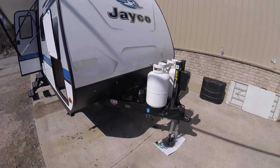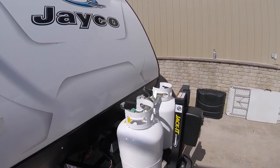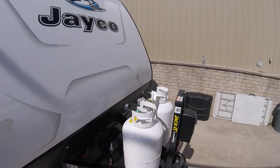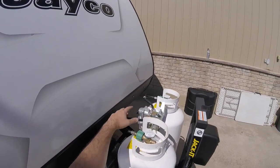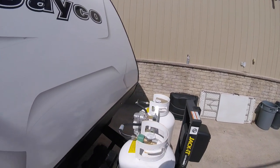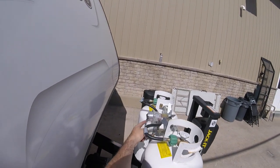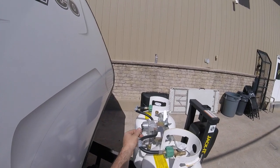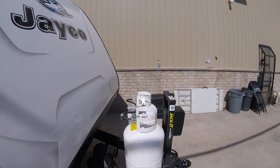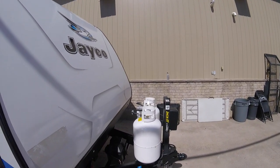You have your 12-volt battery hookup and two 30-pound propane bottles with a crossover regulator, which means you can open both bottles at the same time. It'll pull from the one that the black indicator is pointing to. Once that one's empty, it'll automatically switch over to the other bottle. If you see the little glass indicator is in the red, that means the one it's pointing to is empty. You can switch it over to the other bottle — it'll go clear — and then disconnect the empty one, get it filled, put it back on, and it'll switch over again by itself when ready.